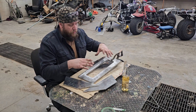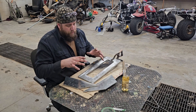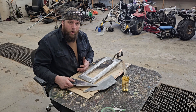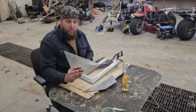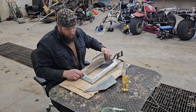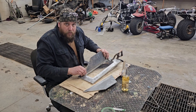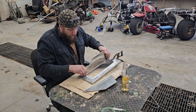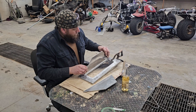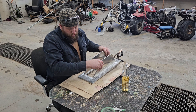What we have here is the part we just cleaned up. I went ahead and measured — basically I hung the blower on top of the engine and roughly measured what I needed to be able to mount onto the intake. That's where these two parts come in. The plan is I'm going to tack them in place with a good solid tack, perfectly on the ends. Having them on the ends allows me to move it a bit. I'm going to add just a smidge of gap — if you put stuff too tight and try to move it, it pries against the weld and snaps it. So we're going to tack the two in there.